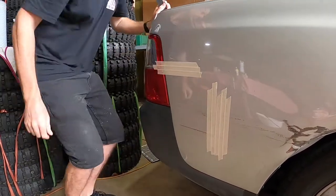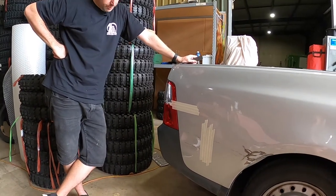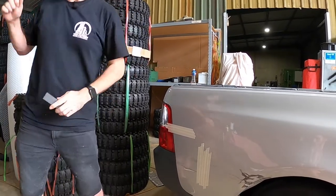Let's get into it. Well hang on — with that plan, because that's quite aggressive, are you going to wet sand it? It needs to be wet sanded. So just hit it straight with the wet sand? Yeah, I think even these light ones you wouldn't be able to do with just a gentle hand polish. So straight to the wet sand.